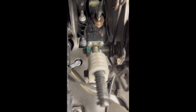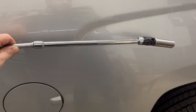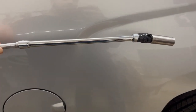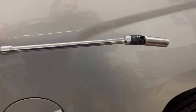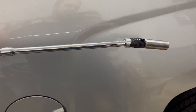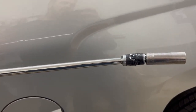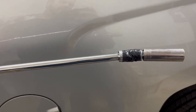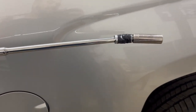It's really hard to get in there and get it focused, but once you get under the dash you can see them pretty well and know what you're going to have to take loose. What I like to use here is some long extensions with a 15-millimeter deep well socket and a wobble extension that's taped to make it a little more rigid — it helps keep it up in there and not let it flop. This is definitely the method I would choose.